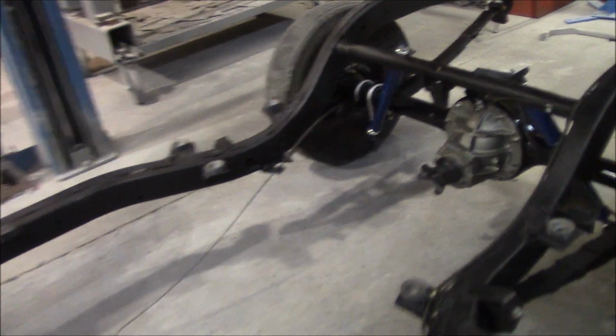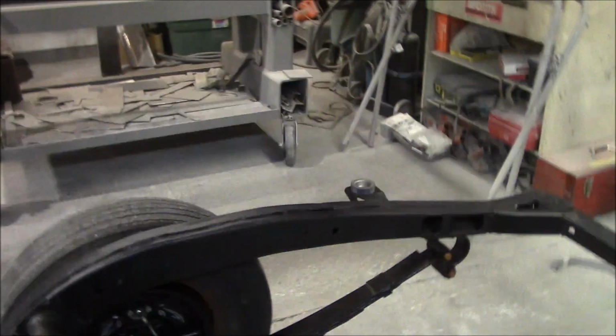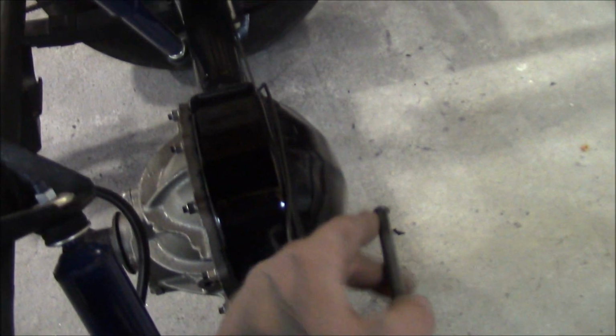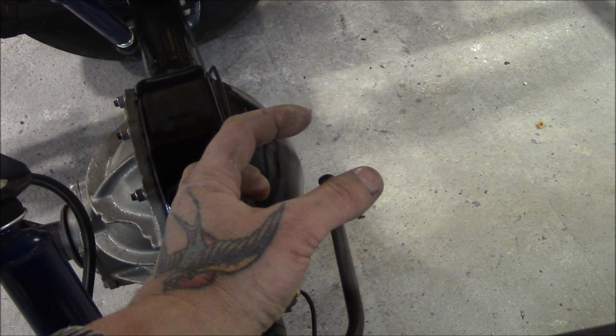So I've run my gas lines. Now what I did, obviously you didn't see it in the video, I've lined up where my gas line is going to go. This is where I've stopped it, and I've got my flared end, because when the body's down on the frame, the gas tank is sitting within this area. Usually what I do, I flare the end up, I put a piece of rubber hose on it, and I put an inline fuel filter here.